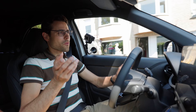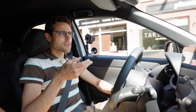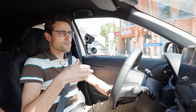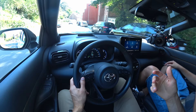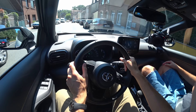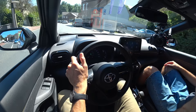As for going hybrid or non-hybrid — when you have the choice on your market — Toyota's hybrid systems are actually very interesting. The question is: are you predominantly doing motorway runs at steady speed, where the hybrid system won't have much effect? But if you have a lot of city driving or topography changes, then it does make sense and gives you consumption advantages. We're now at an average of about 5 liters per 100 km, but we didn't drive too far yet. Going downhill, all the way in EV mode, on a long run you can also score around 4 liters per 100 km — really always depends on the conditions.